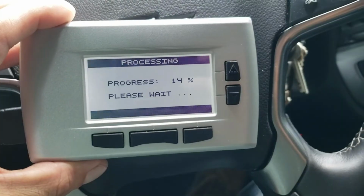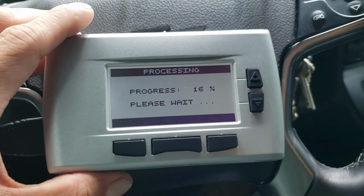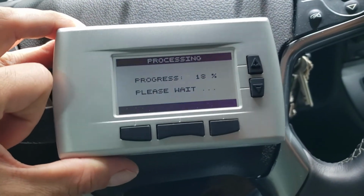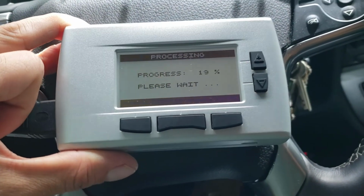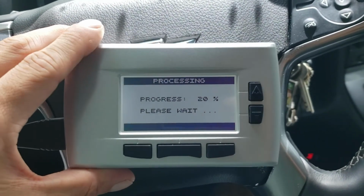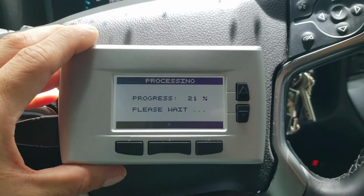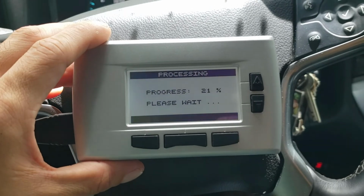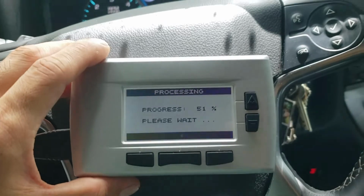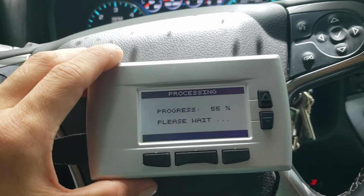Drives a lot better. Alright guys, so I got the Hypertech programmer, the 2.0 here, and I'm putting in one of my final flashes for now, because I tried a whole bunch of settings on this thing, and I just don't care for it too much. I tried the various engine tuning things, and they did really weird things that I don't like. If I stepped on the pedal, it sounded like the thing was maybe knocking, or the engine was having to retard the timing, so when I would step on the gas, it would do something really weird. But anyway, turn that off.